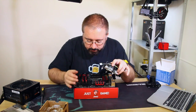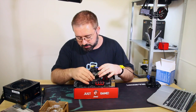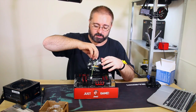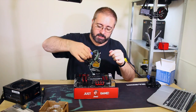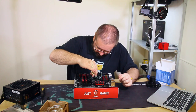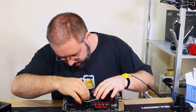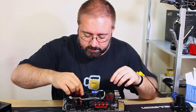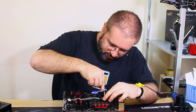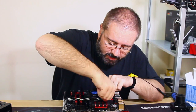There's the CPU fan header right there. It doesn't really matter which way around the cooler goes as long as you can reach the fan header without the cord interfering with the fan blades. Position it nice and square, sit it down evenly for a good even spread of thermal paste, then push the pins in. Best practice is to do opposite corners to get even pressure down.